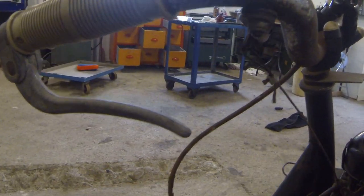When you change a barrel, especially going to an aluminum barrel, it is wise to actually run it in. You shouldn't give it full throttle from the start, and you should add a little bit more two-stroke oil to the mix. It's a bit difficult not to give full throttle on the Velo Solex engine because, at least on mine, there is no throttle — there's an integrated throttle and brake, which doesn't really work on mine. But you should try to be a bit gentle with the engine for the first tank of fuel at least.